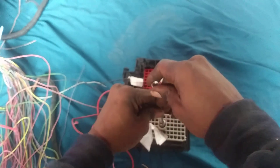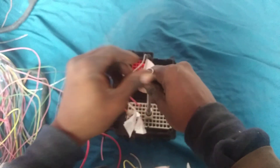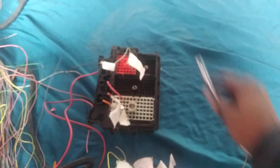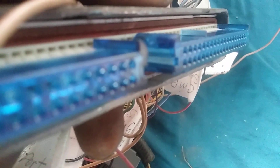If you cut the wires to the PCM, the wires actually come out of the tabs a lot easier - I found that. The depinning tabs are pretty easy: go into this corner right there and push in, then do the other side and push in - it pops right out. Then you'd be lifting up and pushing in the wire.